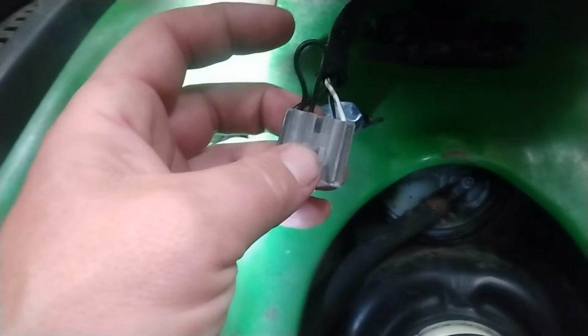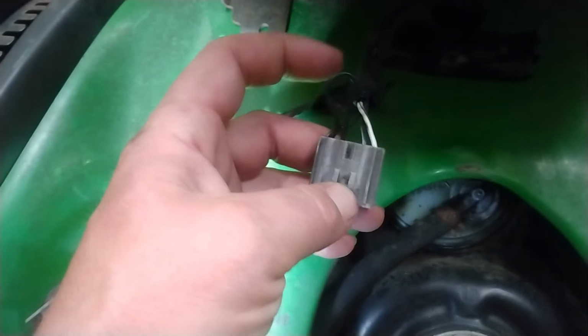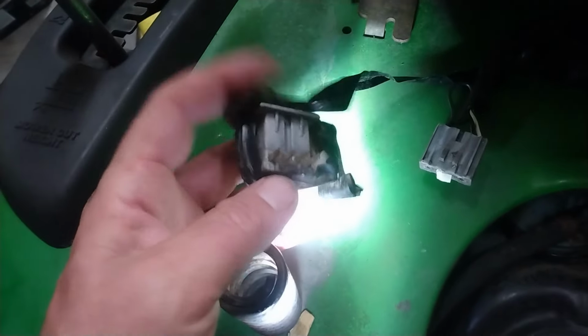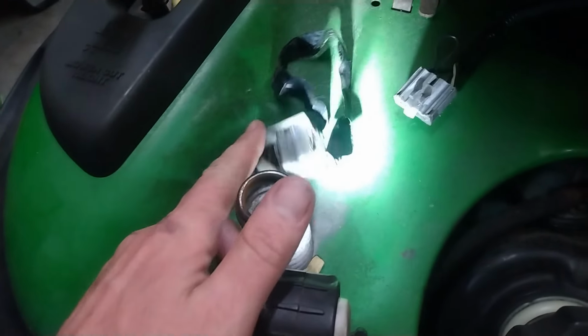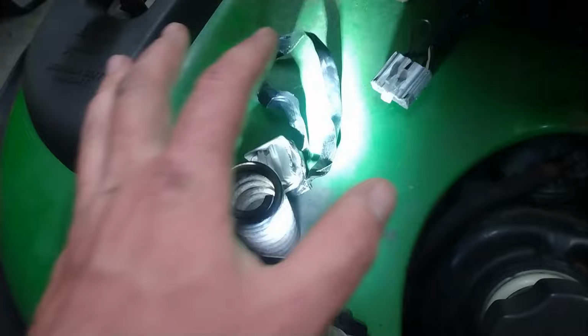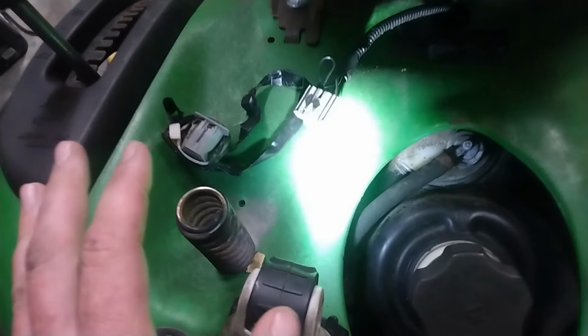And it took me a little bit of digging to figure out what was going on, because the mower will start with it disconnected, but the blade won't engage. And this is basically, from what I can gather, a two-stage switch. It has an ohm resistor, and after reading about these, I understand why people disabled these ones in particular. Most safety seat switches, you're not on it, it doesn't run. So it's very simple, and if you flip your mower over, it's a good thing to have.